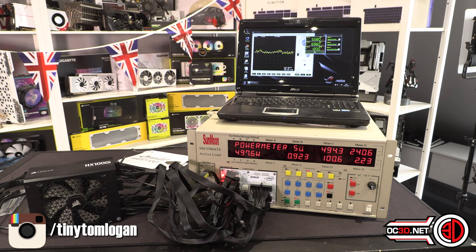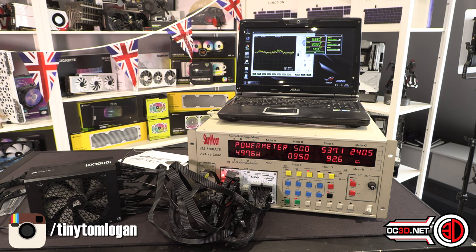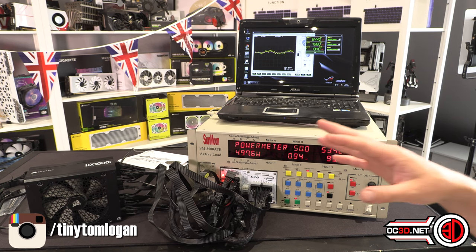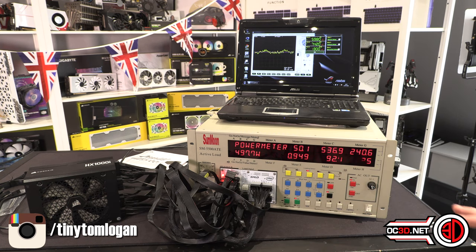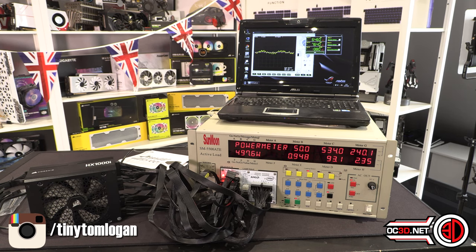At 500 watts you can regularly see 93% efficiency. It does dip a little when the fan spins up, but not by much — I took an average of 92.8%. You can consistently see it hitting 93.1% to 93.2%, which is a very strong result. For millivolts at 50% load, it dips into the 14s but also goes down to 12.2, so I average it out at 13.2mV.